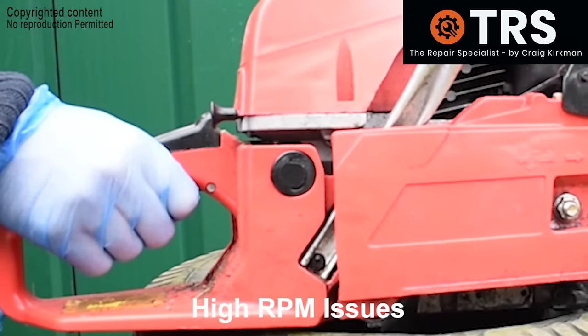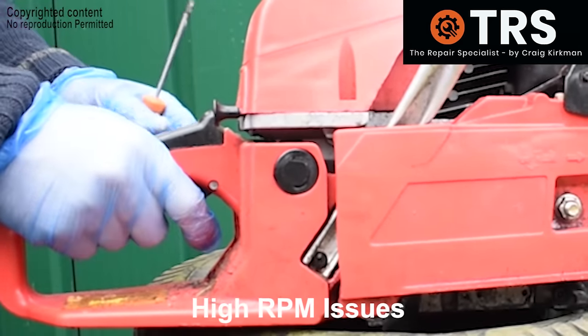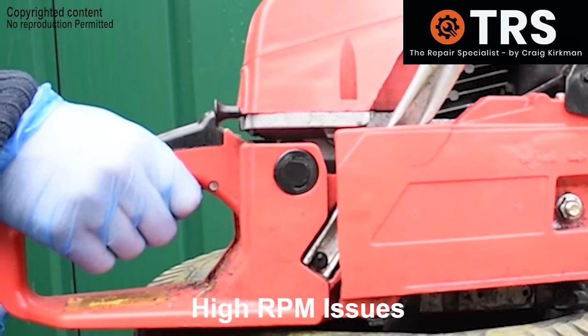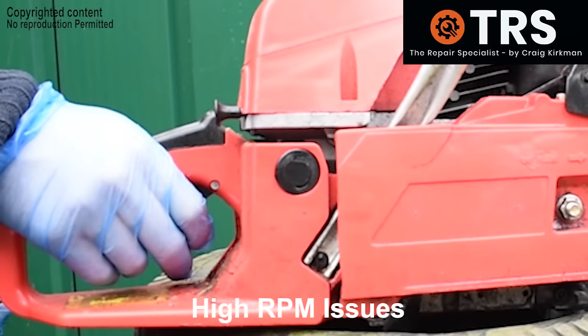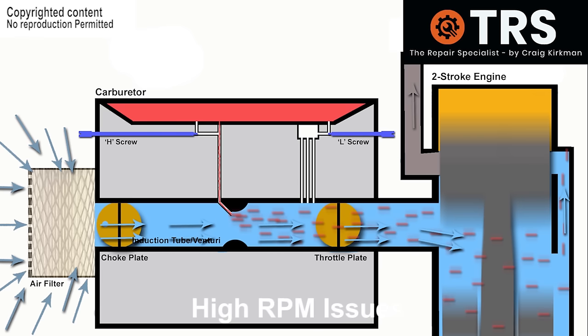But what's happening inside the carburetor to produce an issue where each time the throttle trigger is pulled to rev up the engine, it just bogs and dies? Everything's working fine with the throttle itself — the plate is indeed opening with every pull of the trigger. But for some reason that's not resulting in what should be happening: a higher flow rate of air being drawn through the venturi of the carburetor, drawing out a greater amount of fuel to support higher engine revs.